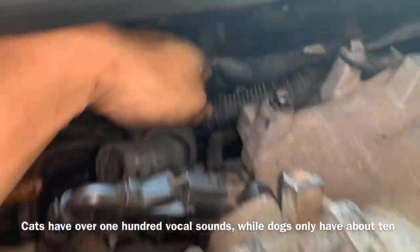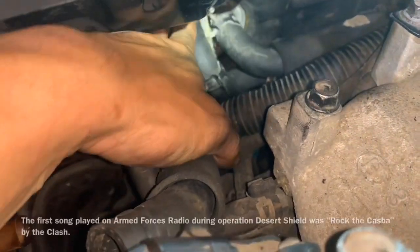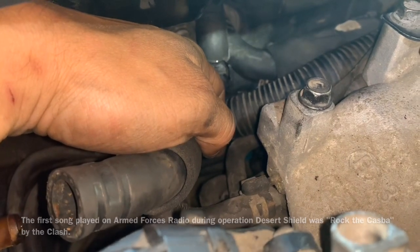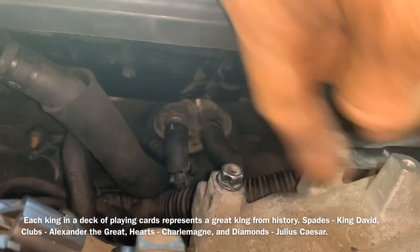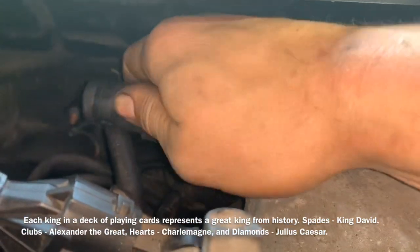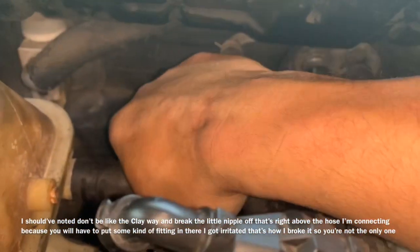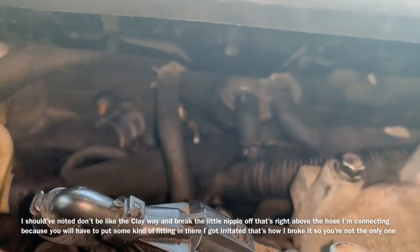I have my tube down inside there. I haven't hooked up my heater hose yet but I can now. I need to get my tube shoved into the intake tube that's coming off the bottom — that's not visible. Now I've got my hose inserted into the other hose that was coming off my intake. I'm going to slip on my heater hose and run this hose underneath here, put a clamp on it, plug it into there, and it's just about all done.